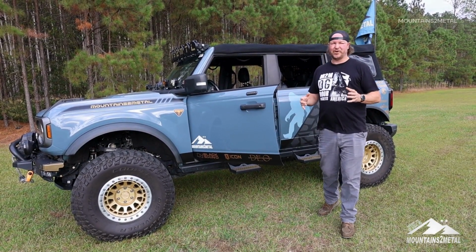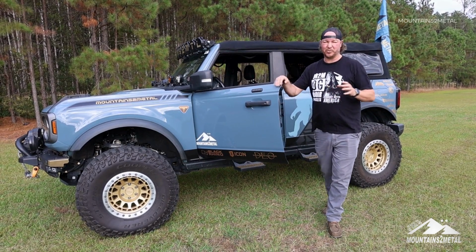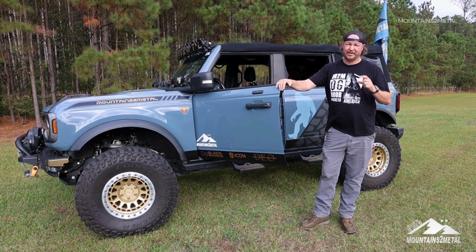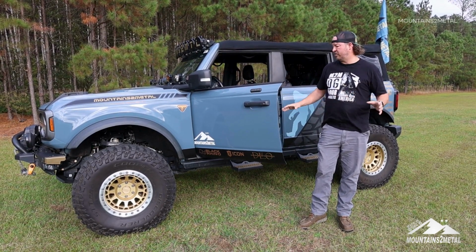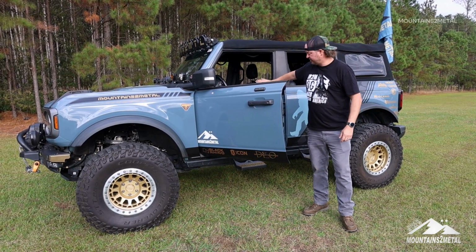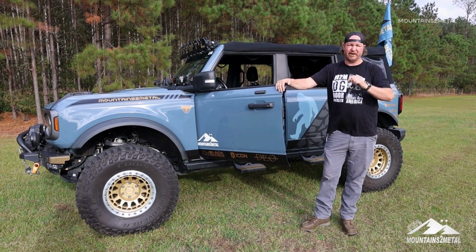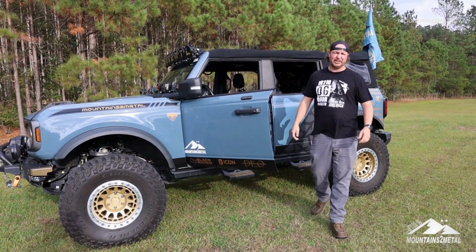Alright, it's been a few days since we've installed the Dynamat and the ArmorLite in the floor. ArmorLite in the instructions did say that their product wouldn't work with other aftermarket products, and I guess I know what they mean now. When we went to do the Dynamat, I thought for sure, since the Dynamat is very thick, the fabric on the bottom of the ArmorLite would compress a little bit. Wasn't too worried about it. Overall, the whole install went really good, but near the end, we did have to trim a few pieces on the sides here and in the back where the supports that hold up the back seat. We had to trim maybe an eighth to 3/16 of plastic off of it because the rubber ArmorLite floor did raise up a little higher than it probably should have, but overall you can't really tell that we did that.